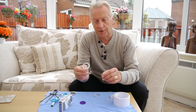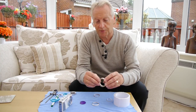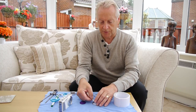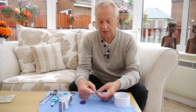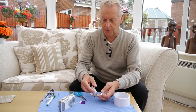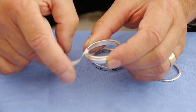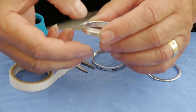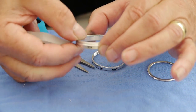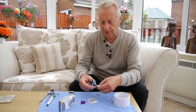I'm going to try doing that with the ring now. In the original prototype I used 6mm (quarter-inch) wide double-sided tape as a protective layer. What I did was stick small pieces of this around the outside edge of the filter and cut them off until I had sufficient adhesive around the rim of the ring to stick it to the camera. I actually fitted six of these small pieces of double-sided tape around the outside of the lens, and then trimmed the tape as close to the filter as possible.